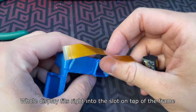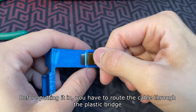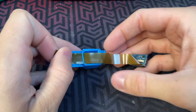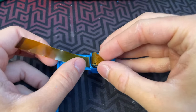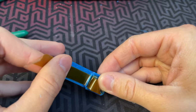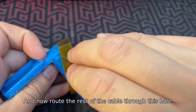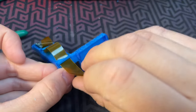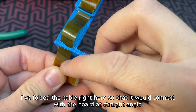The whole display fits right into the slot on top of the frame. Before putting it in you have to route the cable through the plastic bridge — once again be very careful and delicate. When the cable is halfway in, put the display inside the frame, and then route the rest of the cable through this hole.